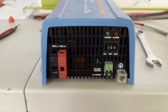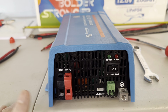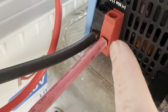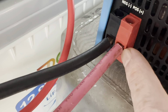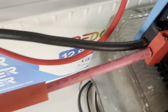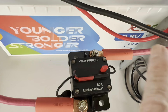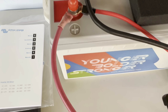Now I'm going to cut the six-gauge wire to fit and take it to the battery with the 50-amp breaker on the positive run. This went together really well — they take a nice bite onto the copper at just over half an inch, giving a real snug fit with plenty of bite on those strands. I've already got my heat shrink slid up in there so when I disconnect I can tidy that up. I did put the 50-amp breaker in on the positive as I said I wanted.